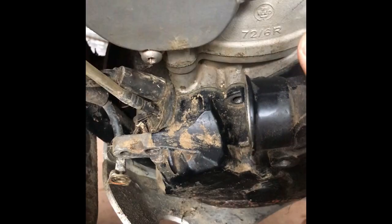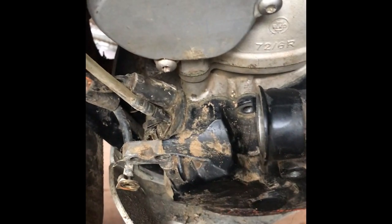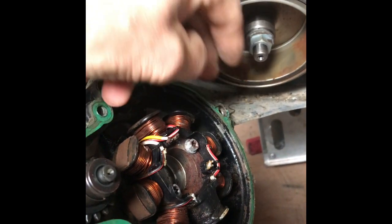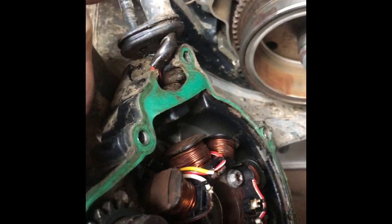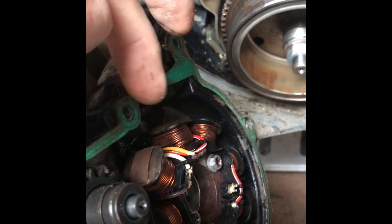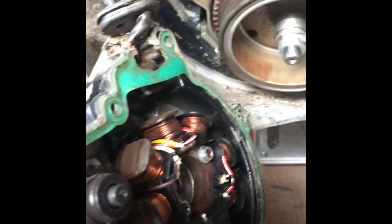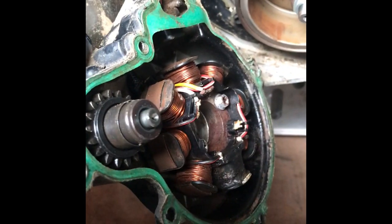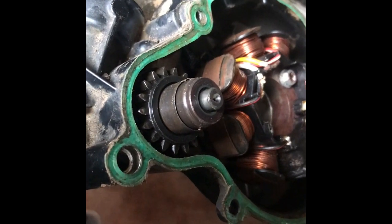I did the wet mod but this case is all loose now and it should just come off. I'll disconnect that and take it off. I've got a bit of a split in the gasket — it's not for oil or anything, it just keeps grime out. I've done the wet mod modification: you seal it up at the bottom. When these were made new there was a vent at the bottom, and if it got full of water it's supposed to drain out, but it would get blocked up and just stay there, especially if you went in deep water.